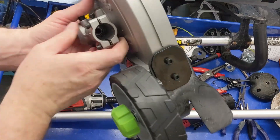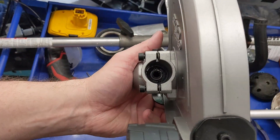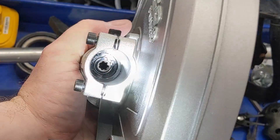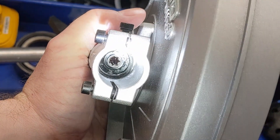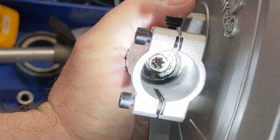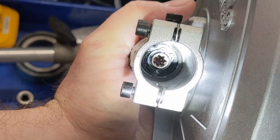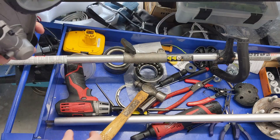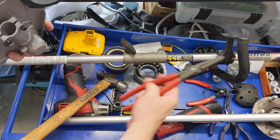It is brand new. Let's see if we see anything inside here where the gearbox is. The spline looks great — it's a seven spline, as all EGO stuff seems to be. But we do see here — I know it's tough on camera — see how wide that snap ring is? It should be in a groove. So it's not seated properly, and that's most likely our only problem.